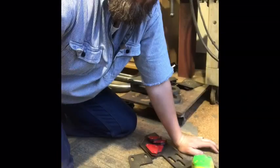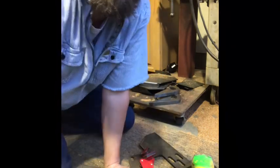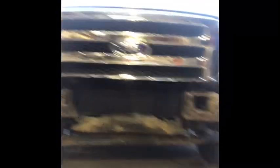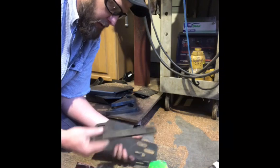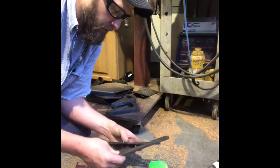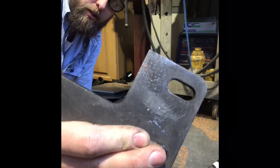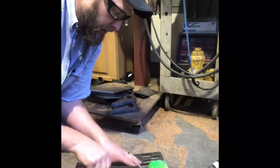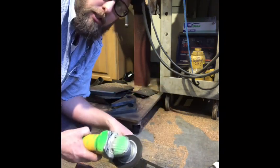Brought the Excursion into the garage. I pulled the tow hooks off, got some space cleared up, and got the grinder out. I started fitting the bracket pieces together — the pieces that bolt the whole thing onto the Excursion — and I realized these corners right here need to be cut a little bit straighter for it to go together more smoothly. So we're going to hit them with the grinder and get it done.